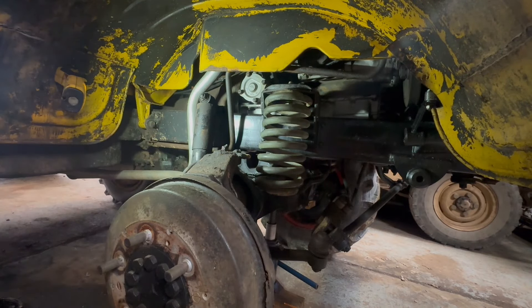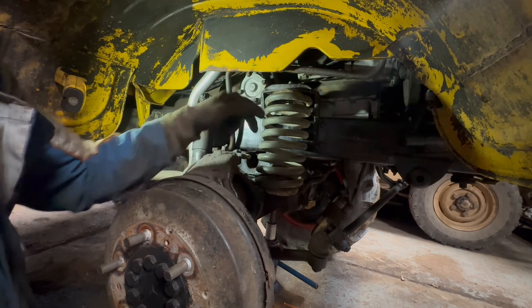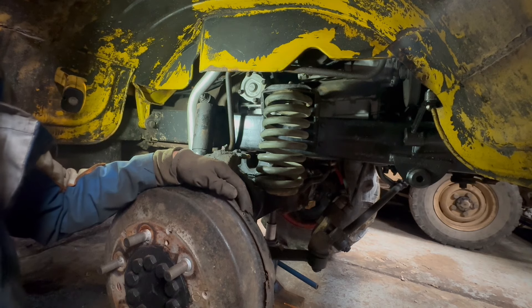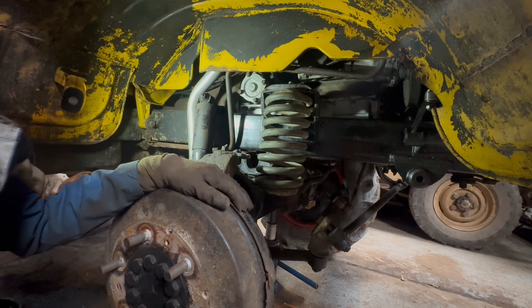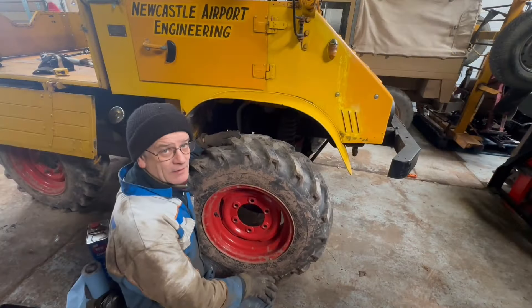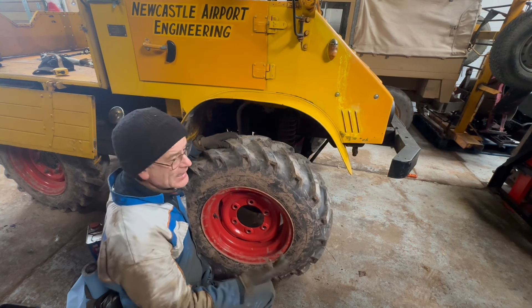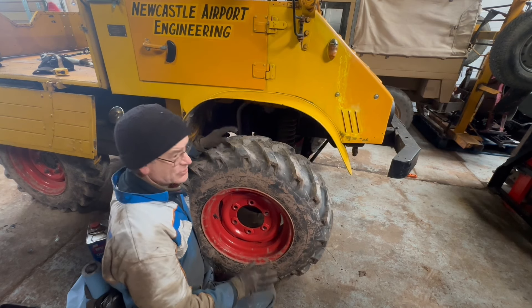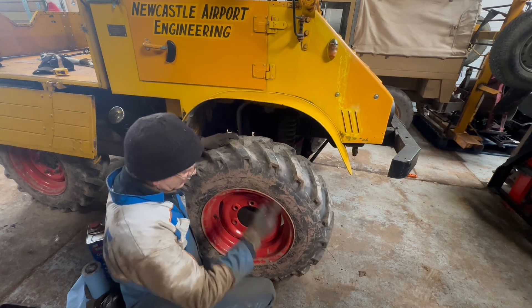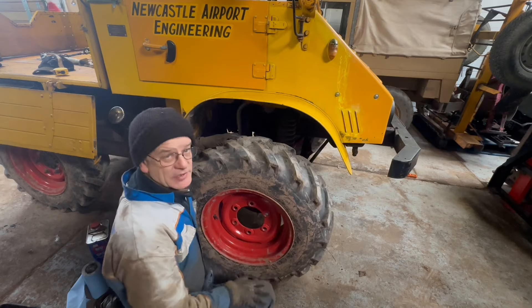It's in and under compression. Let's see what the gap is between those coils now - 12 to 13 millimeters. It was 11 on the 421 but this vehicle's a little bit lighter. I'm going to do one final check to make sure they're tight enough and then put the wheel back on. Before anybody says I'm putting the tires on the wrong way around - on Unimogs it's always been that if you're mainly using the vehicle on the road you reverse the tread direction. It's a unidirectional tire on the front axle. If you're doing a lot of field work you swap them around the conventional way. I'm doing some field work but probably more on the road, so I'm reversing the tire tread direction.